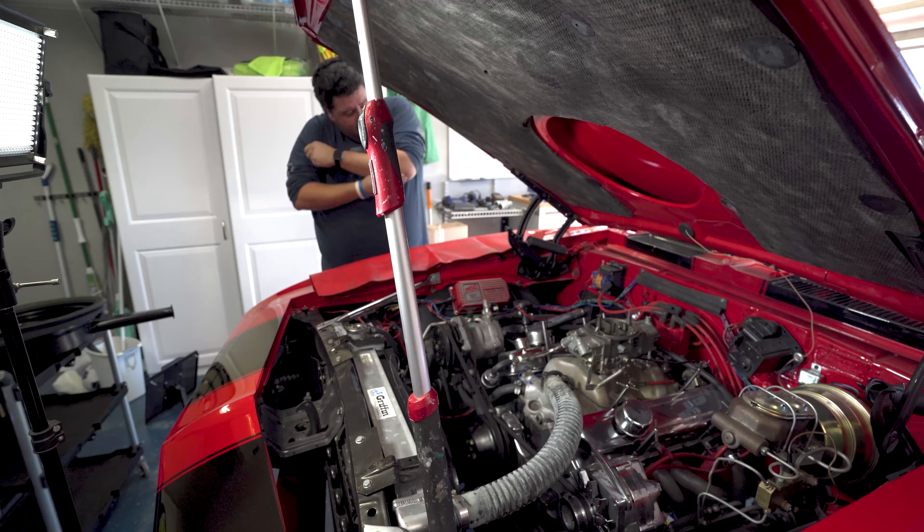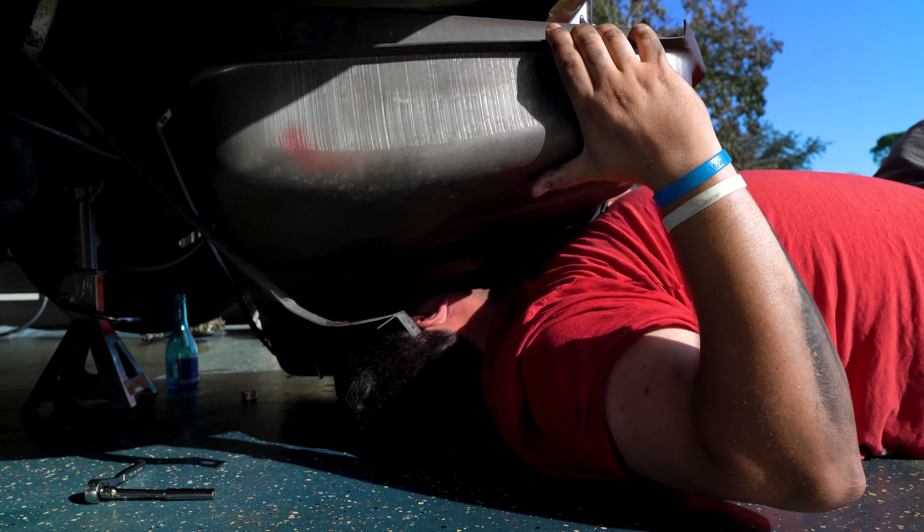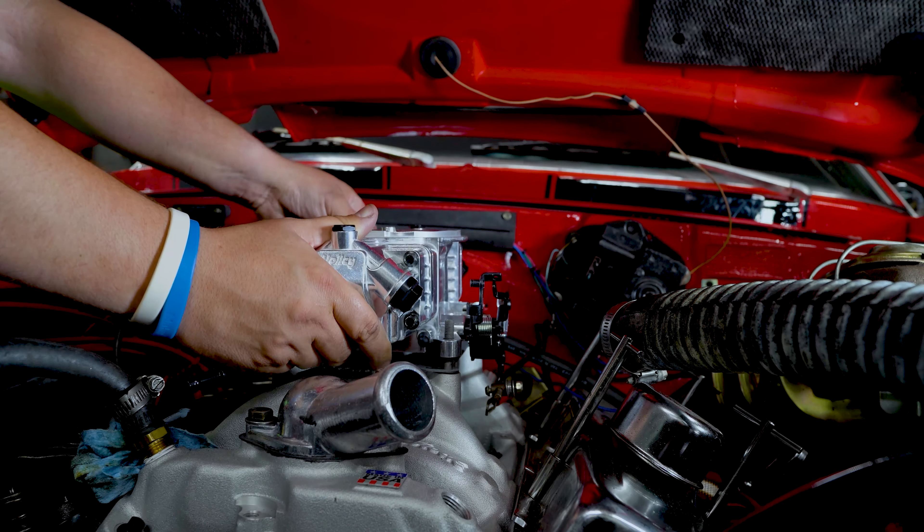Another question I get is: was it hard to install? It's really easy. You put it on just like a carburetor, hook up one connection to positive and one to negative on the battery, connect your engine coolant temp sensor, drill a hole in your exhaust for an O2 sensor — they provide the O2 sensor, clamp, and all the seals. Those are the main connections, plus adding a fuel line with a fuel pump. You don't have to integrate it to your ignition, though I did to get better fuel economy, more power curve, and more adjustability.